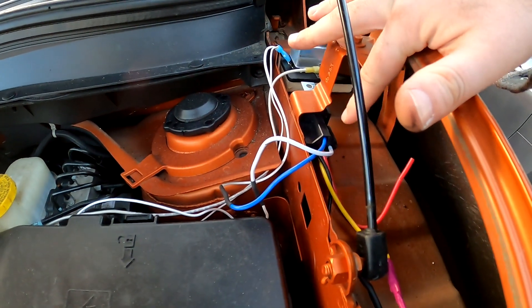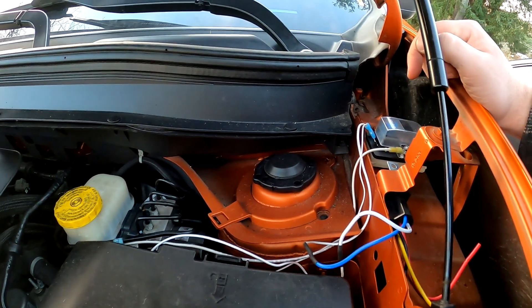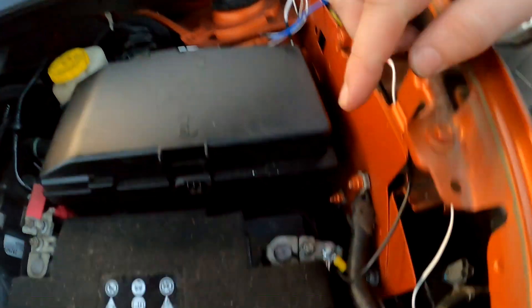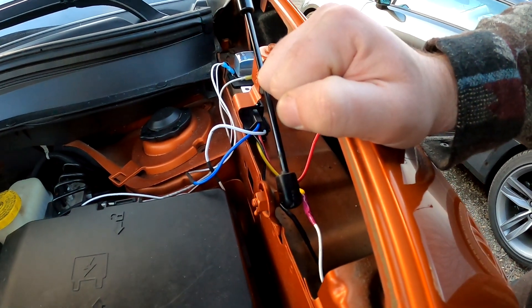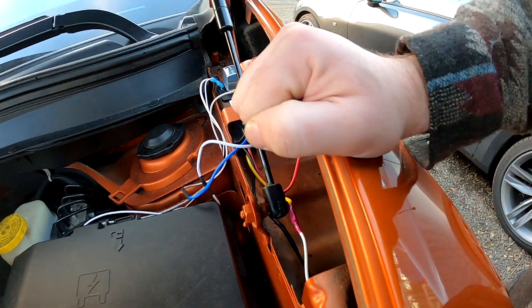In the future you could add more relays coming off the fuse block. It may also be worthwhile to get a second fuse block to serve as a ground block rather than doing everything at the battery — one line going to a central point and branching from there. But for now we're very happy with how this works.